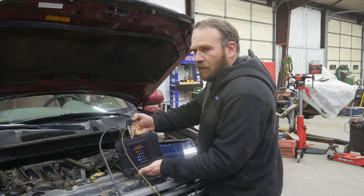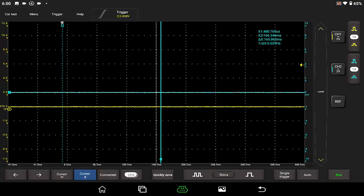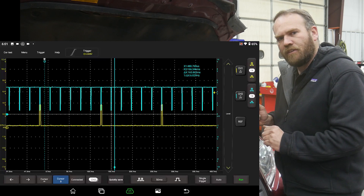I have the second channel connected on top of the scope. Let's grab channel 1 and back-probe into this coil — it looks like I'm around ground, so that might be our ground wire. There's the next wire, and there we have a small square wave. I'm going to take a guess and say this is our trigger signal because of the spacing of those pulses. If this was our feedback signal where all the coils are connected, it would be a more repetitive or closely spaced pattern. Let's take our second channel and go to the next wire — and there's our feedback.